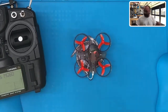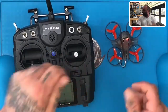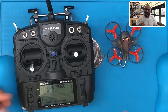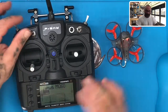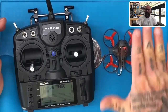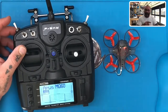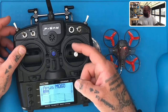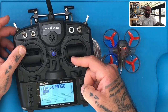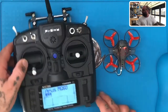I'm going to put this on my desk. One thing I do want to show you guys before you take off ever is: when you're plugging your drone and sitting there moving it all over the place, it doesn't know where level is. So that calibrate accelerometer is really important, and you can do that from your radio. Take your left stick and go to the top left and hold it there — don't push it hard, just hold it there. Bring your right stick and hold it down for three counts: one, two, three. Let go, bring your stick back down, and now your drone knows that that's level.